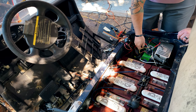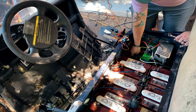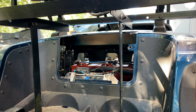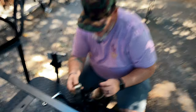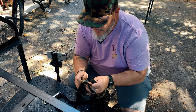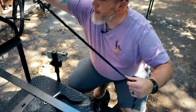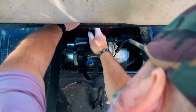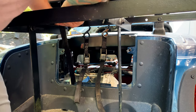These three cables are connected to the top of the motor and we have to take the motor completely out. I'm going to straighten these cables a little bit so they won't pull on anything else when I pull it out from the rear. In the rear we're going to take our straps and loosen them up, then drop them around the motor to hold the weight while I take it loose. We're going to feed the strap under the motor but over the rear axle and pull it secure.